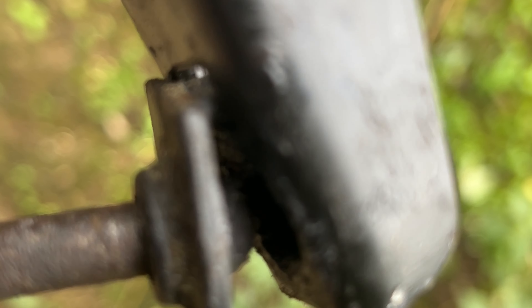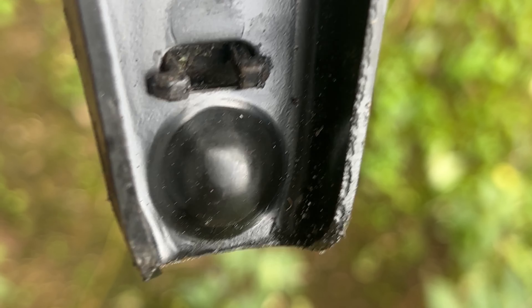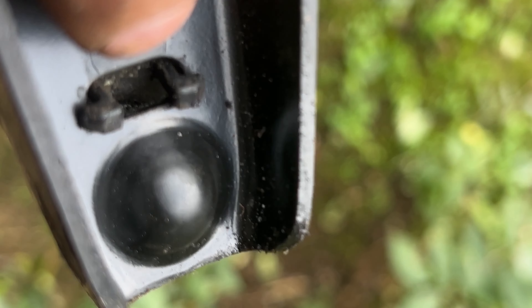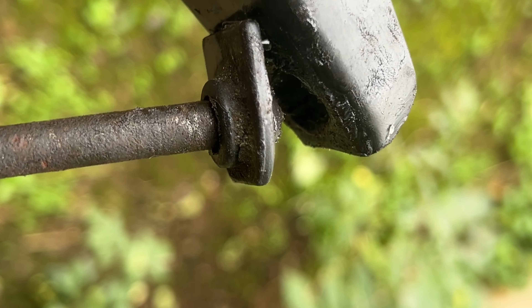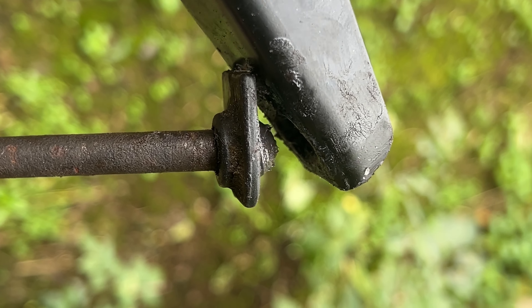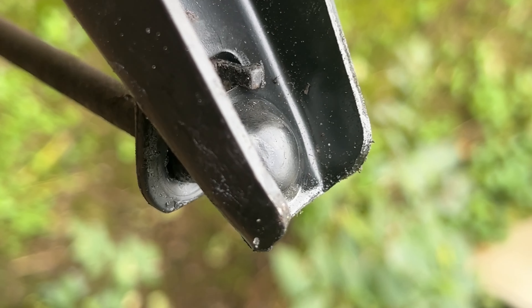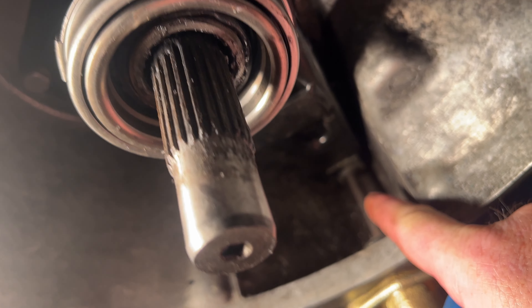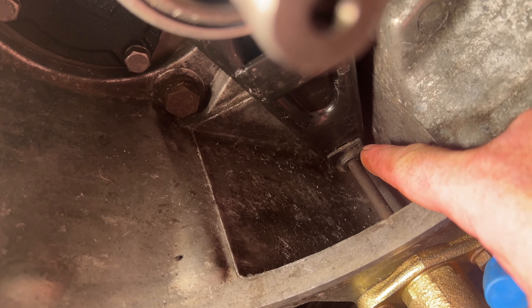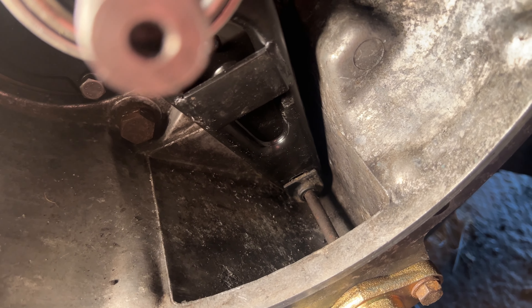There's the little clip — you can see it's in now. It's got two little spring clips that just pulled through that little slot, which is why the lever came off. That was the only issue, but it's taken hours to correct. Now let's put it all back together. There it is — all in place: slave cylinder, little lever, and the offending little plastic clip, which hopefully won't come off again.